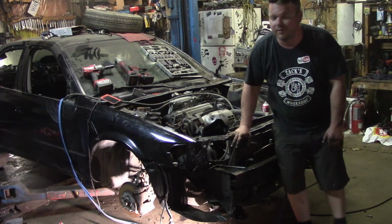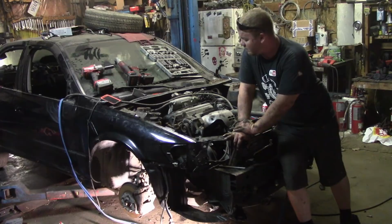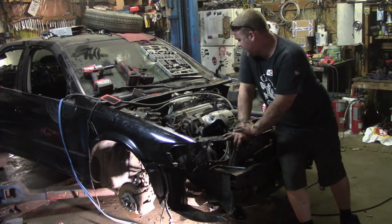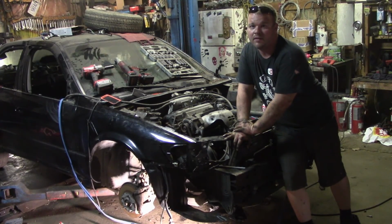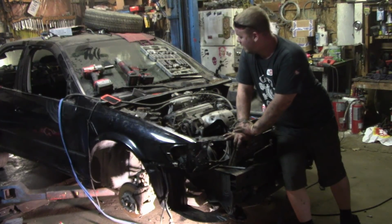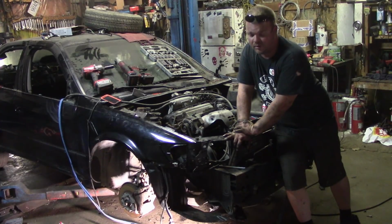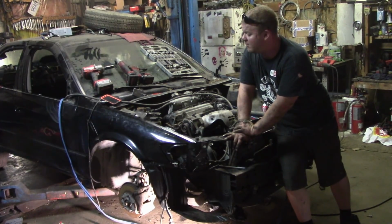We've done a Toyota Camry timing belt on this vehicle here. I bought it non-running and diagnosed that it had spark and fuel, and the next step was to check timing. Once I checked timing, I realized that was the issue. I fixed it up. A little 45 minutes to fix the timing belt, and this car is good for a demolition derby now, and now it runs.